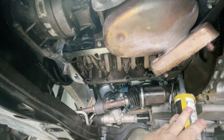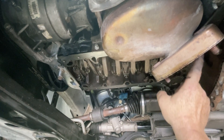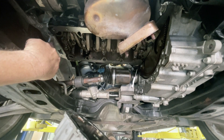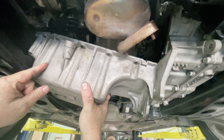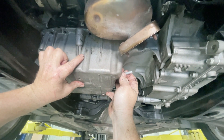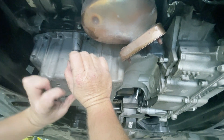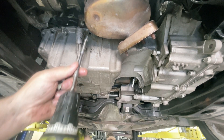And up in there — just going to do a nice smear. I don't want to push it all away, just want to have good coverage there. Then we're going to run the sump up. It's great to have a couple of bolts in your hands ready to go just to hold it in place. Also be careful that you don't smear your silicon out of place because it's a really quite tight fit up and into there. If you've got one of these side bolts here it's quite easy to push it up and get one in place to hold that end. Then get one of the smaller ones started up in there. I'm going to run around and put all these bolts in, but I'm really just putting them in quite loosely initially.